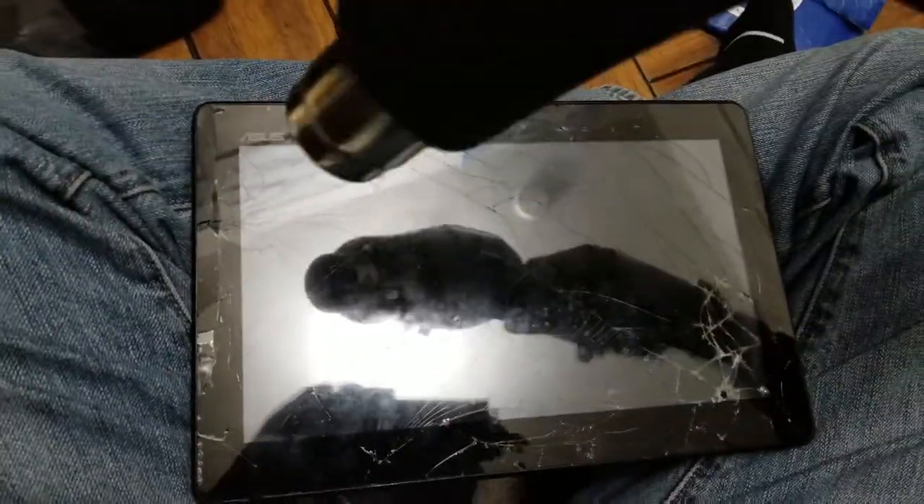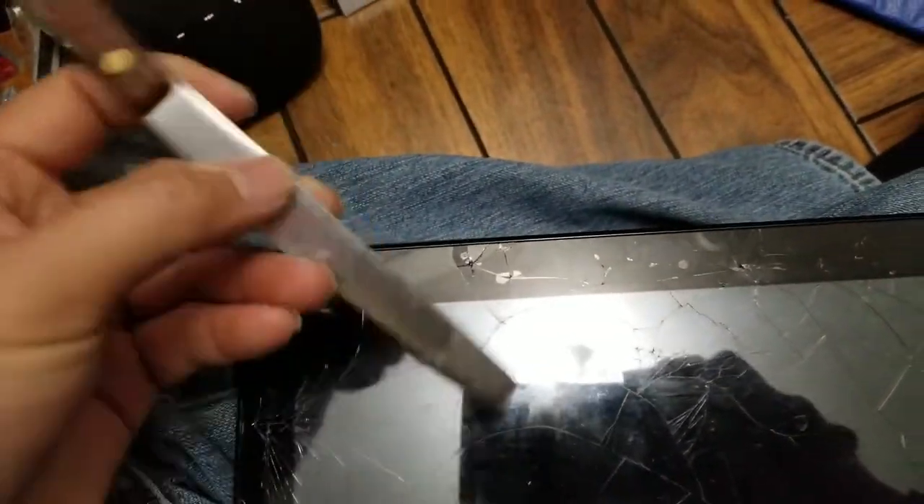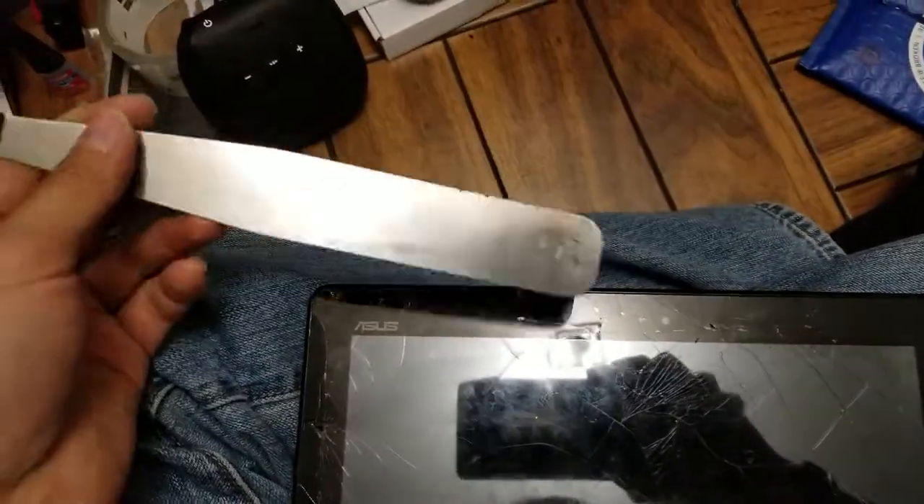At first what I did was I actually pried this out. If the adhesive is hard to pull, you use a heat gun and heat it up. When it's warm, just slide a small pry tool. This one is like a pill-scooping tool pharmacies use, or a larger frosting spatula. Pretty much you can use anything small and flexible — guitar picks, playing cards, things like that.